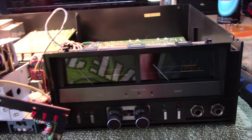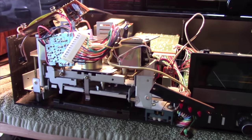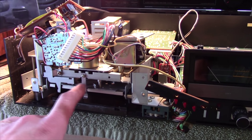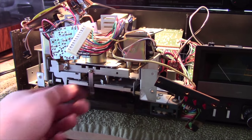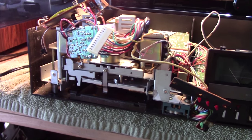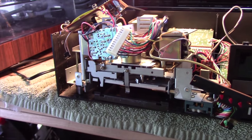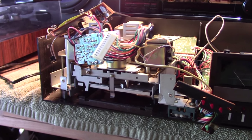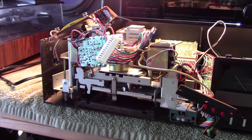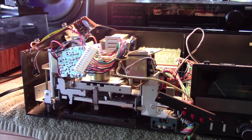This is one of Fischer's higher-end decks, early 80s. It has an aluminum faceplate and there's a lot going on — it's a dual-motor direct-drive deck, although it looks like some of the drive mechanism is still using rubber tires. That's kind of a bummer that they weren't using gears yet. The capstan turns, but the take-up reel is not turning, and the other one's a little sluggish when reversing. They don't feel stiff or gummed up, but I'm guessing I'll have to replace the traction tire.